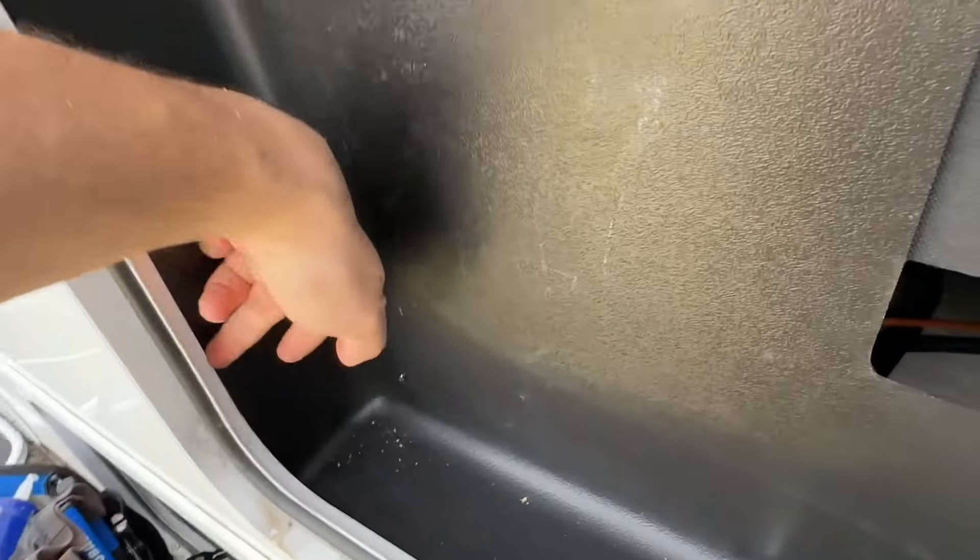It's basically saying 'come on in, water' — and all it takes is a little tiny bit of user error. This outer seal is critical. Even a little pinhole here is different than a window leak, because with a window you'll see a line inside your RV and go, 'what's going on?' and address it. But here, when this is behind a couch, there's nothing for you to ever notice. You get a little leak, water pools up, and one day you open it and find water in there. Good thing you put silicone in — because now you know the water didn't go any farther than that silicone bead.